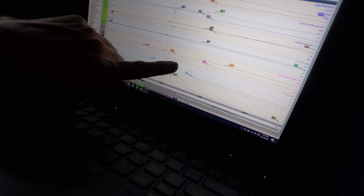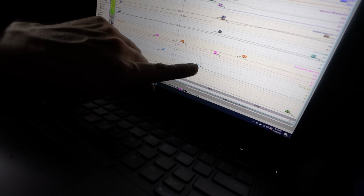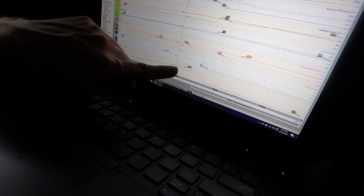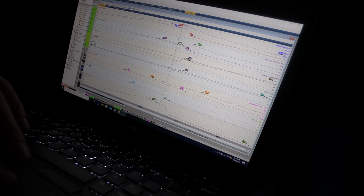You can see my TPS. This is the boost. We have about 48% duty cycle in it, and then I dropped it down a little bit at the higher RPM. And then you can see the injectors, basically that's the duty cycle, so about 82%. So I think it was just losing a little bit of fuel pressure up top, and I just didn't want to push it and keep turning it up at that point.